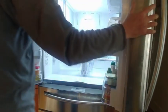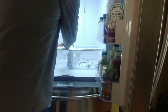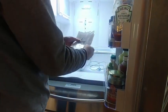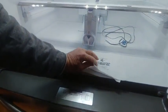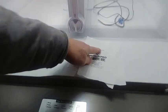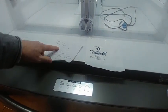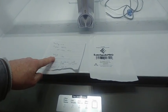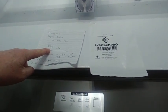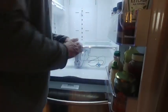Something has changed, so there's your heater. I bought this one off Amazon — you can order this one. It's an EP SH-201, but it's actually an original Supco SH-201. These are an 18-inch, 15-watt, 120-volt. You can get the 13-inch as well — some people buy the 13 and that's the SH-205. You just tie-wrap it to the plumbing in there.